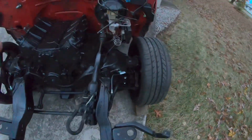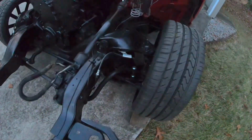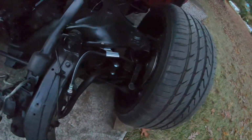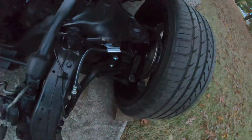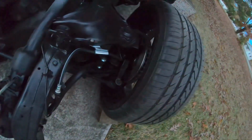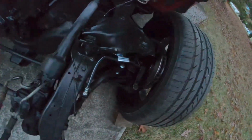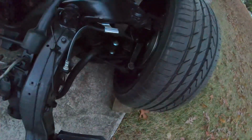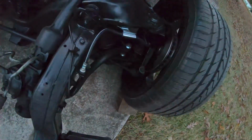So I did a 3-inch drop spring in the front and 2-inch React spindles in the front. I had to go with the bigger brakes for the 93 to 98 trucks, the 1.25-inch rotor and bigger caliper, because that's all that will work on their spindles.